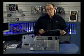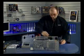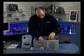Next I'm going to cable the CD-ROM drive — that's going to go on the secondary ATA. The master connector will go to the drive, again orienting pin one towards the power connector. And then finally the floppy cable, the last connector here, with pin one oriented towards the power connector on the floppy drive.